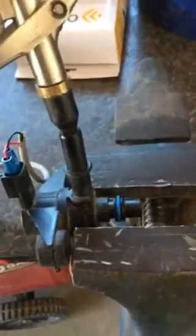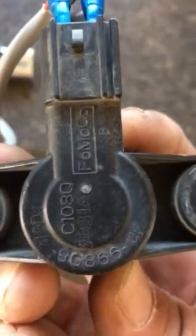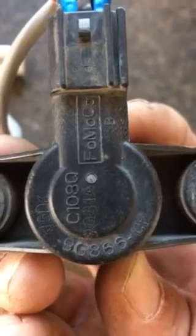It should not allow gas to pass through. I wired it up to a little 9-volt battery just to hear it work — it definitely works. If I put voltage to it and click it, it certainly opens up larger. The fact that it leaks is the actual problem. Part number: I believe it may be C1080. This is the culprit on the 2010 Escape and maybe other Ford vehicles.